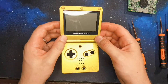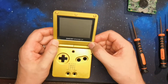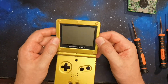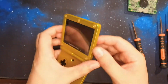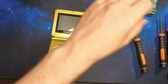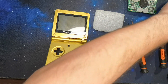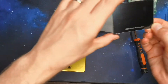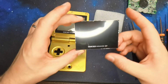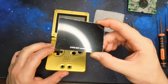Let's move on to the disassembly stage. I need to remove the rubber covers here, here, here, and here, delicately, since these are the only ones I have. Behind them you have four screws holding the screen. We're going to remove the old screen, which is much larger than the new one — and the new one will need to be shimmed with this small foam. I'll show you the IPS screen again — it's really very, very beautiful. You'll need to make some small modifications, a bit of tinkering on your console, cutting small bits of plastic. With a Dremel or cutting pliers, it's really very easy to do.